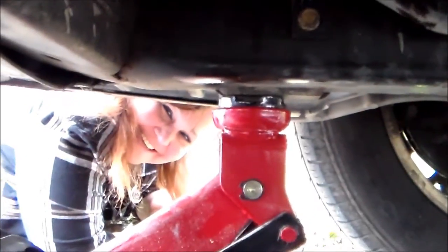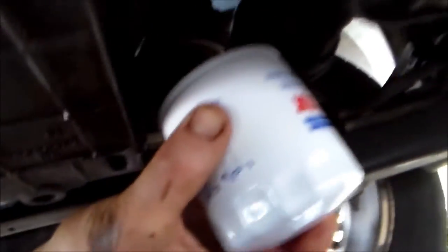Okay YouTube, now we're going to put the new oil filter on — that's where it goes. A stray cat came over and I gave her a snack, and now she won't leave. Here's the new filter. As you can see, it's at an angle. I still got the pan under her just in case. Like I said, you never want to put it in empty if you can help it — always at least get it saturated. And this is all I'm doing to tighten this up: just my hand, and that's it. That will not leak. If you have a leak when you do that, you've ripped the seal or you've got other problems.